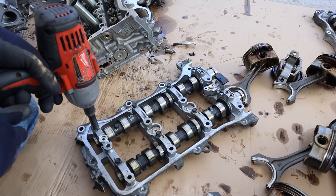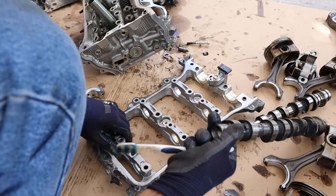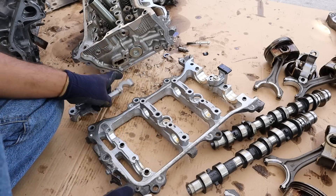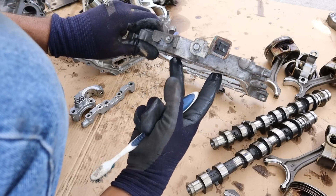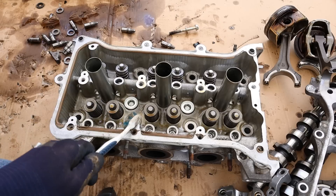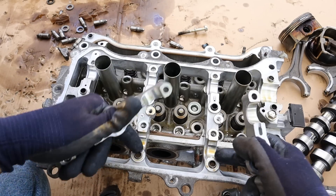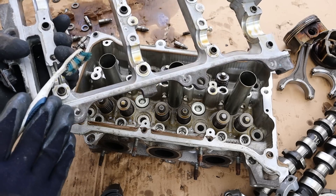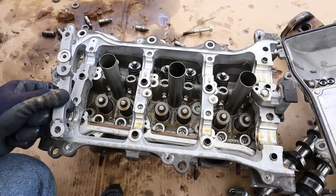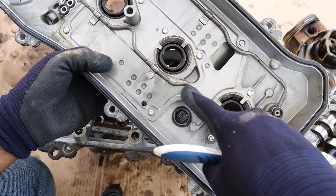I'm going to take off the camshaft so you can see how the oil flows. We'll take off the cam caps — these are all fixed together. In order to lubricate these cam bearing surfaces, if I remove the cam cap here you can see a groove that brings oil from that hole across the two cam caps. In addition, the oil splits off through two holes down to the bottom where it feeds back into the head. That oil then comes back through two holes where it fills the two oil galleys for your hydraulic lifters. There's another two pairs of holes that feed oil back up through the valve train assembly to lubricate the two middle cam bearings through small holes coming back through the head. There's also an additional hole on top of this cam cap that interfaces with the valve cover to spray oil on top of the camshafts.